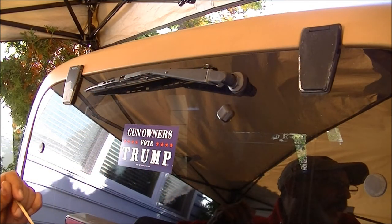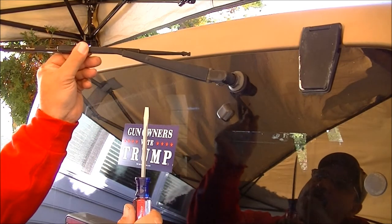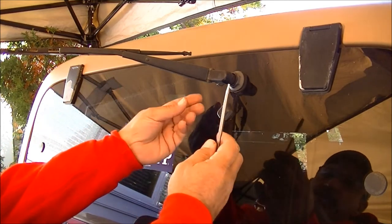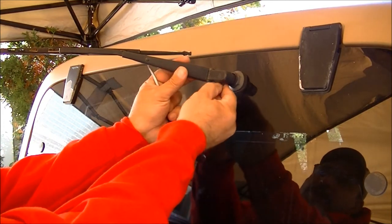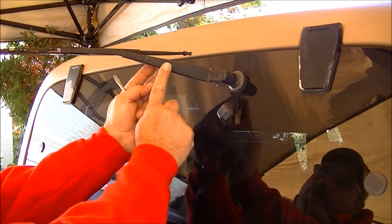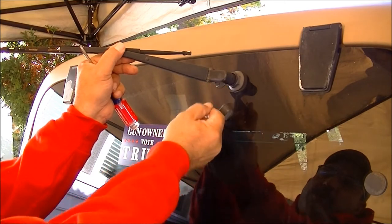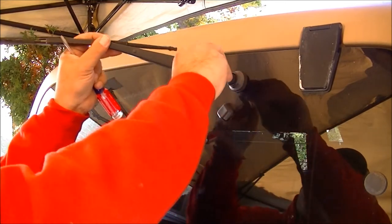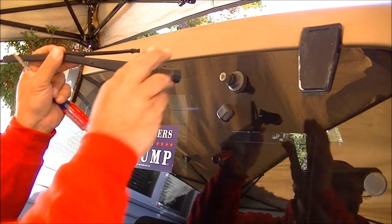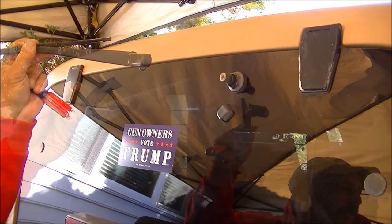Up at the window, all I have is a flat blade screwdriver. You pull the wiper arm out — straight out as far as it'll go. Sometimes you need the screwdriver, sometimes you don't. There's a tab right here below the mechanism. When you pull the wiper blade all the way out, it releases a lock that lets you pull this tab down. Once you pull this tab down, you should be able to pull your wiper arm right off. Sometimes you might have to wiggle it up and down a little bit if it's gunked up.